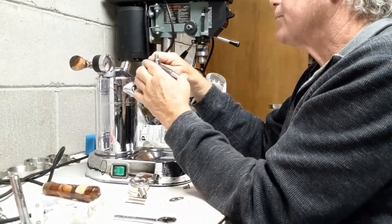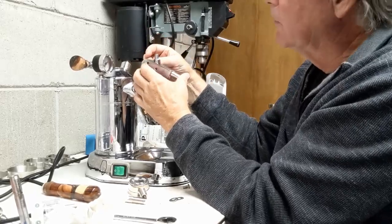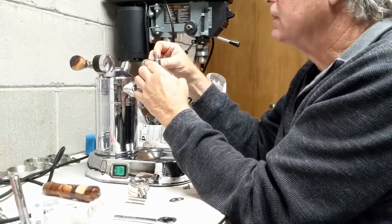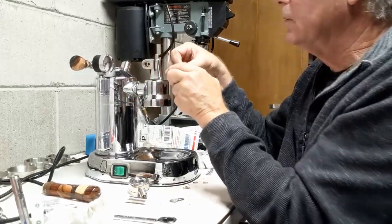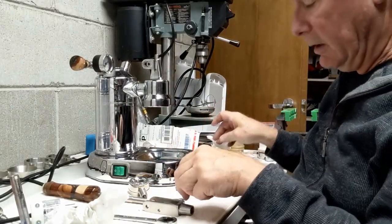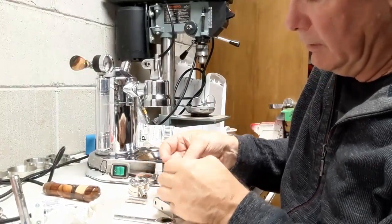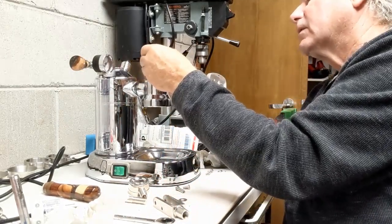And I could actually hammer the fork together a little bit, but then that would push the screw out on the back side. He's made them just the right length from one side to the other. So we're going to end up just doing this. We're going to end up doing the two washers. And you don't have to do this, but I'm going to. What's nice about using a little grease on it is it actually holds it in place.